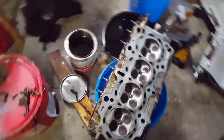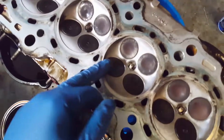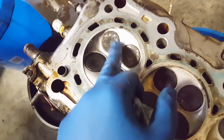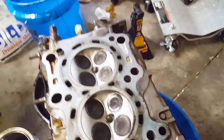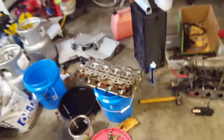I've gone ahead and used the toothbrush and you can see I got the rest of the carbon buildup off. There's a little bit left on the valves — primarily the exhaust valves — but there's almost no carbon buildup within these cylinders, and that's a really good sight. Especially if you're putting together a rebuilt motor, you want to make sure that everything is nice and clean. These pistons from that same chemical are also cleaning up very well.